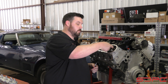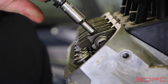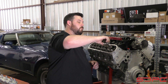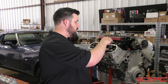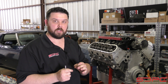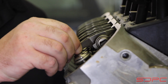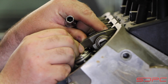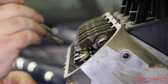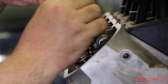We're going to take this rocker arm, put it here on the intake side, and tighten this in by hand. I've got a little tool here to help me spin it faster. We're going to spin this all the way down and make sure it's just finger tight. What we're looking for is zero lash — it might be a little loose, but we definitely don't want it tight. It looked like I might have gotten a little too close on the first try; there's not very much wiggle room in here. Let's back it off and try again. There's a lot of trial and error with this procedure, so have a little bit of patience — it'll pay off in the long run.